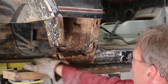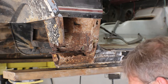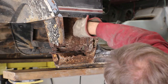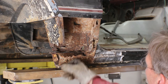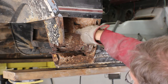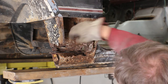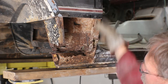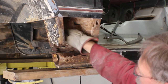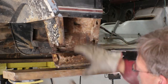I've gotten all this essentially cleaned out now. There was another mouse nest obviously, and there's still some hay up in this section. Right now all of this is rusted out and the rocker panel is completely gone. What I'm going to do is try and cut as little of this out as possible so I can use it as a pattern to rebuild. I want to rebuild this inner structure and outer structure of this B-pillar, and then rebuild the inner rocker portion, and then go in and rebuild the inside part of this panel once it's all structurally strong.